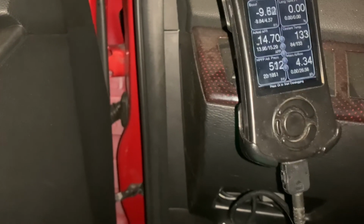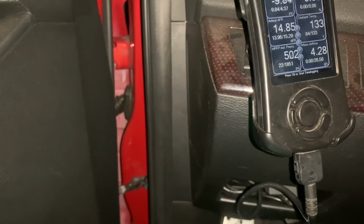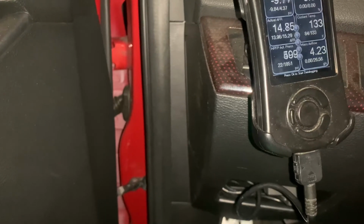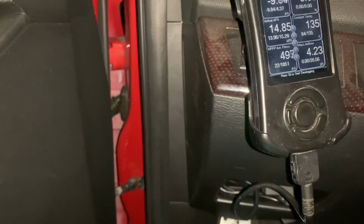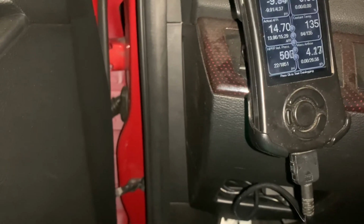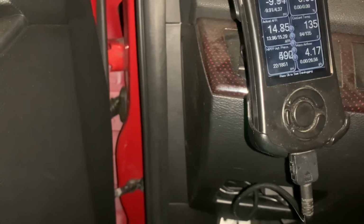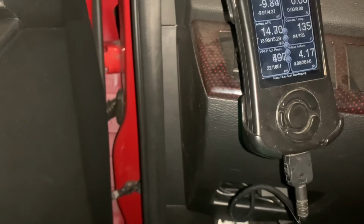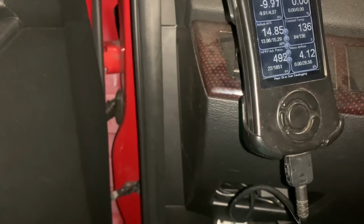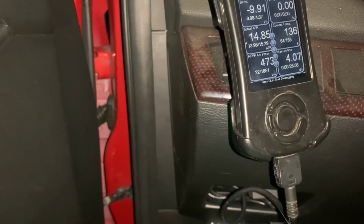But yeah, my car, like I said, when I did that, when there was pressure in it, and I just turned it to the on position, the pressure would sit at 33 with the car being off. I was told that's how you test it. You just turn it to the on position, and if it sits at under 60 to 70, then it's bad. Your high pressure relief valve is bad. And like I said, mine was at 33. People told me they're supposed to sit at 60 to 70.